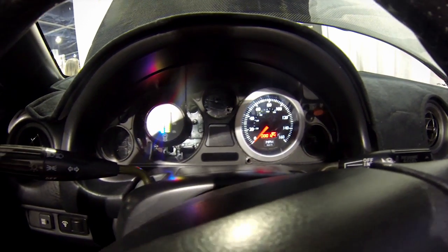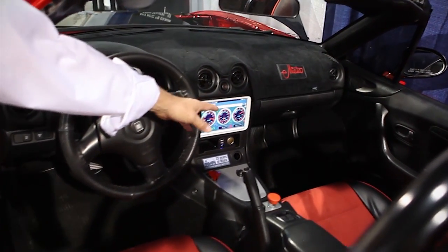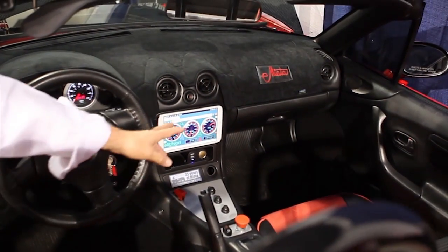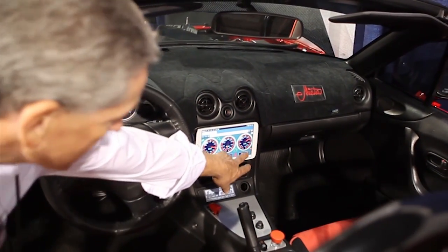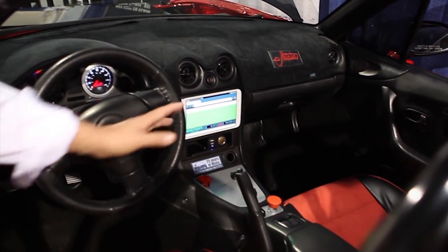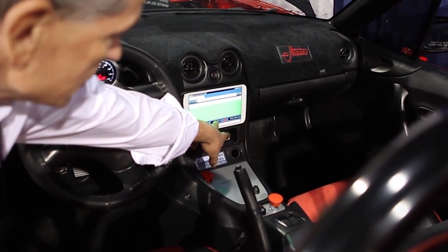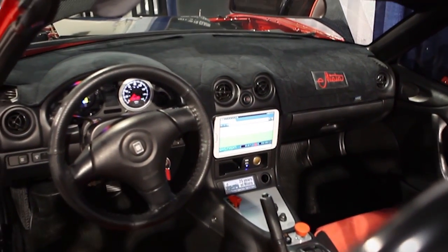For gauges in the car we're just running a local motor speedometer. We have a state of charge gauge and then we're using a wireless tablet. The car has its own hotspot so we can read our volts, our amps, keep an eye on all 100 battery cells, the state of charge, and we can also look at the temperature of each given cell so we know exactly where we're at. No range anxiety.